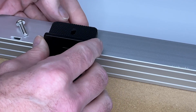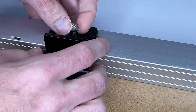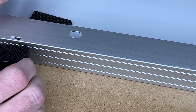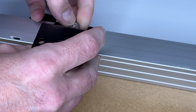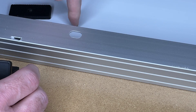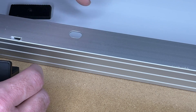Since I can adjust my crossbars, I should be able to mount these wherever I want. I'm going to put this under here — this is very close; the bolt is right up against this edge and I almost need to file it down just a tiny bit. If you have to drill these and you're using a drill, you can plunge the drill bit in, but there's a good chance you're going to hit your solar panel, so you definitely want to back it up with a piece of wood so when you punch through the aluminum the wood takes the shock.